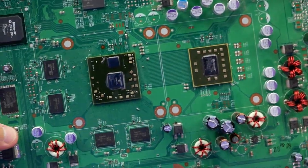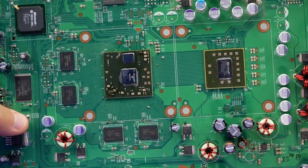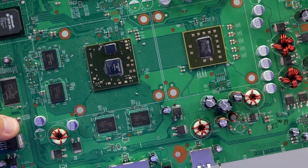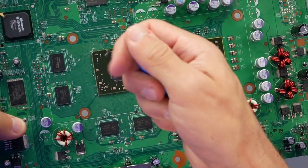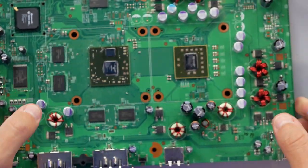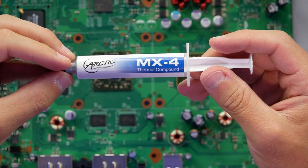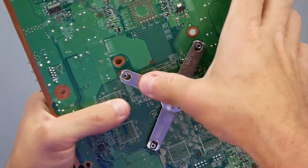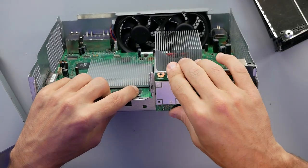The chips look pretty good. Some of the thermal compound will stick at times, but this was actually pretty easy to remove — it wasn't dried out or seized too badly. For any components with compound sticking around them, a plastic spudger works well to slowly scrape it off carefully, and it also works on scraping the heat sinks. We'll use the classic MX4 thermal compound, drop the heat sinks back on, reconnect and press down the X-clamps, and we're good to reinstall. At this point I just need to put it together and test it with a game.